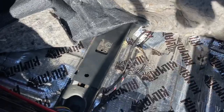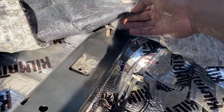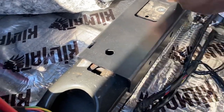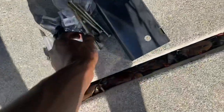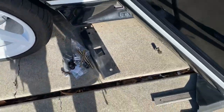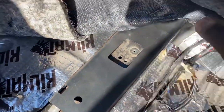Alright, so I got the carpet folded up and as you can see, there is no stud — but there is a stud there. So pretty much this goes here. I need to mark these holes on both sides and drill them out so that these screws will shoot through here on both sides and hold this mount down. I ain't gonna cut it — next time y'all see it I'm gonna have the stud here and everything will be bolted down.